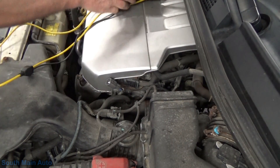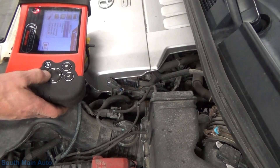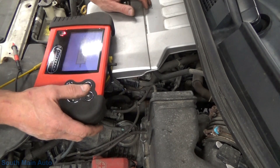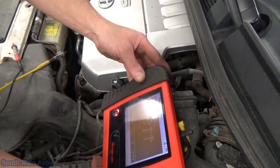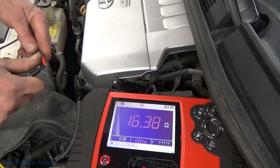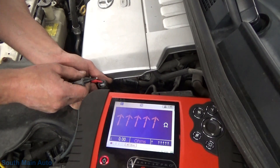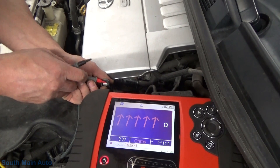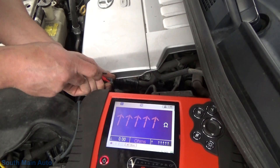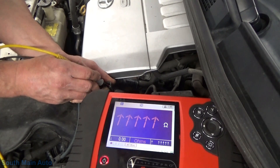I've yet to see it not be true — it's always the same-colored pair for the heater circuit, whether two black wires or two white wires. I don't know the exact resistance spec, but I assume somewhere between 2 and 8 ohms. I suspect it's going to be open-circuited anyway. I'll get unplugged and go right across the two black terminals. And there we are — she's open-circuited. That's pretty definitive.